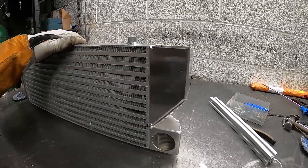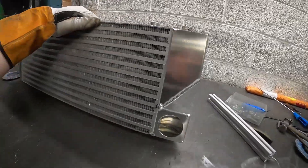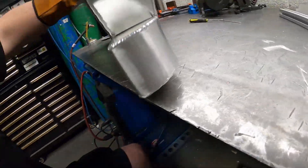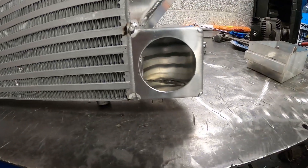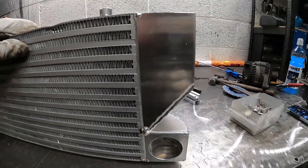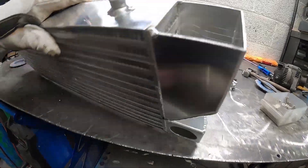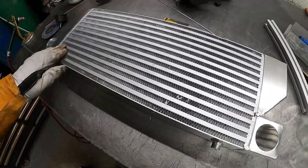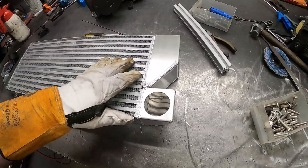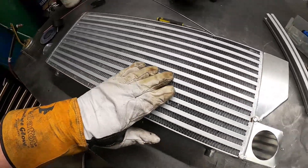We've got the end tank to hold it on now. Hopefully this makes it a bit more clear. We've got this little end tank at the bottom here which is going to be for the supercharger — the supercharger will get that portion of the intercooler. The turbocharger, which we're doing most of the work for, gets most of the cooler and has its own separate end tank. So the supercharger flows through there, the turbocharger flows through there — if they're both running together over the crossover period they won't interrupt each other's flow.